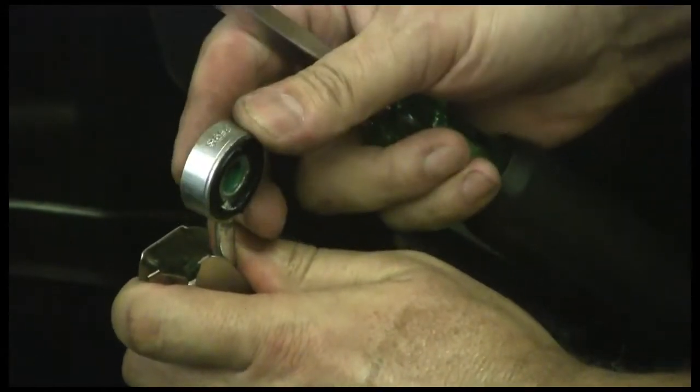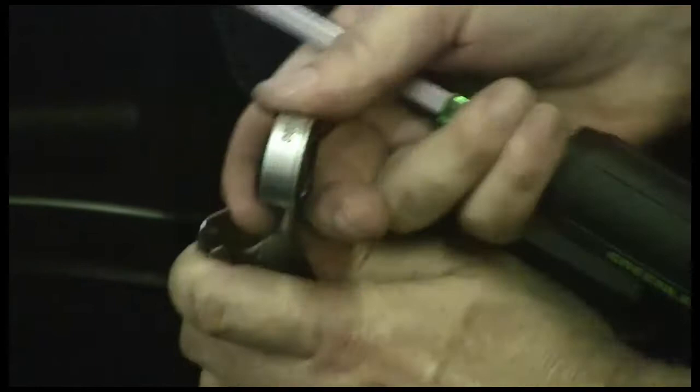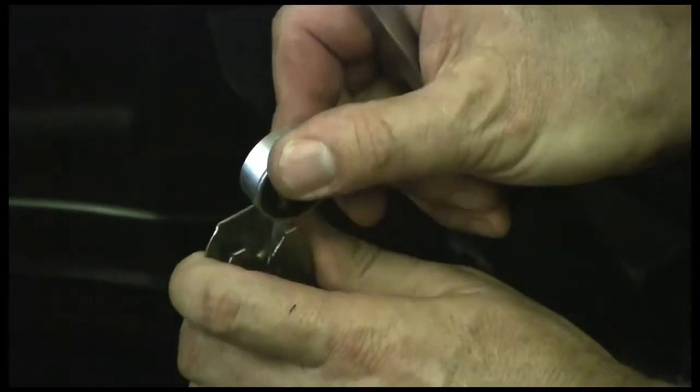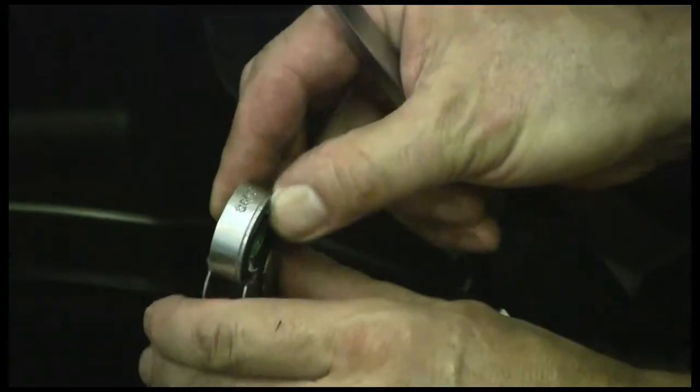You've got to give it a good tug, maybe a little bit of help with a helper, and you just pull it right off that ball joint on the transmission — it will just extract right off of there. And now we have removed our gear selector cables from our transmission.